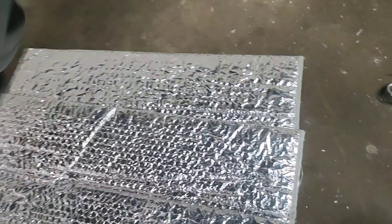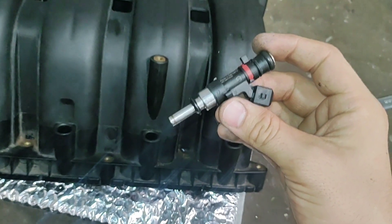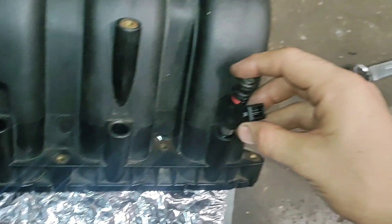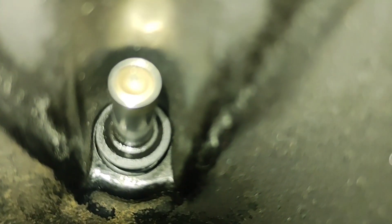Another thing that's often overlooked: when you use an aftermarket fuel injector and install it, if you look inside the runner, the injector can actually go too far into the intake manifold past this channel, because there is no ridge to stop it. It'll go in and the O-ring will push all the way into the runner. And if the O-ring swells, the injector is stuck. And for that matter, you have a vacuum leak and boost leak above the injector.